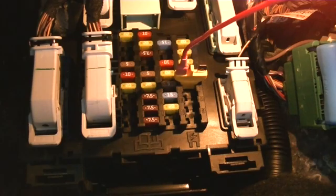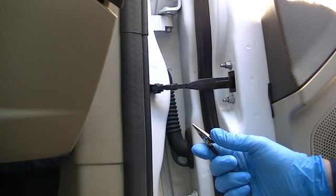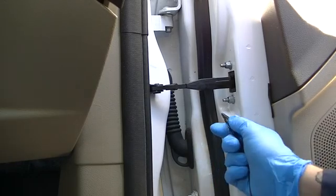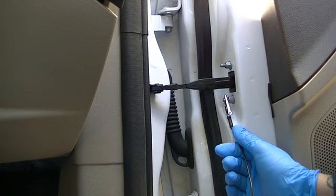I do have the potential to put power on the incorrect side, which is something we will discuss later. I need to have the ground wire of the repowering device connected to a good vehicle ground — in this case, I'm going to connect the alligator clip to a metal bolt protruding through the door hinge.